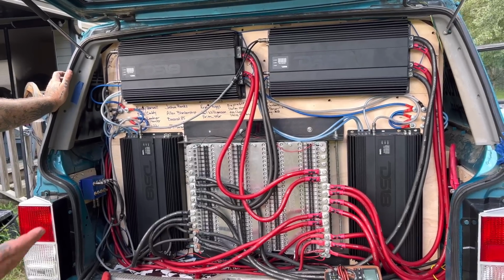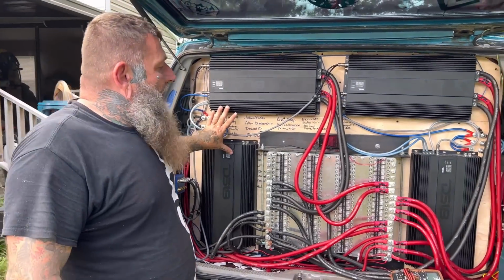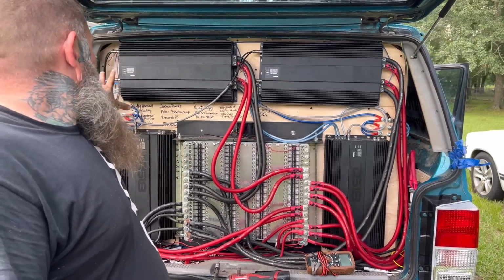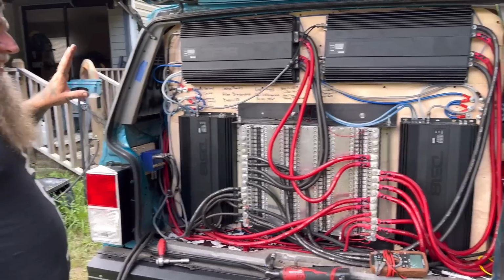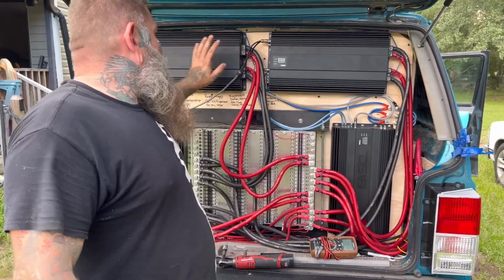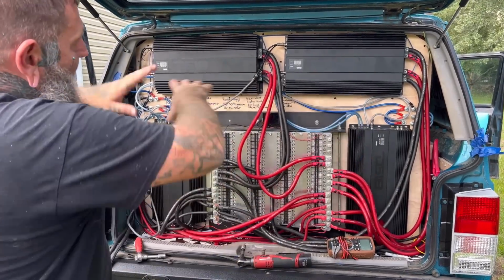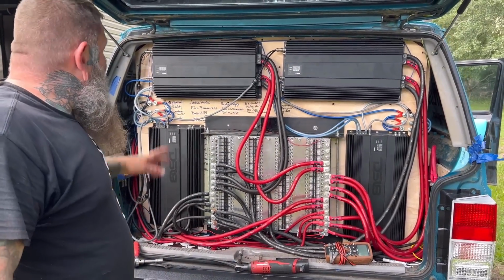And that 210 volts that I get out of these two, all I'm going to do is turn everything off, unhook my multimeter, hook it up here, start everything over. I'm going to turn the gain on this amp up till I get that 210 volts this one was at. And then they'll be gain matched. And I shouldn't have a clip light at all. Then my gains will be matched. And it'll be time to hook subs back up.